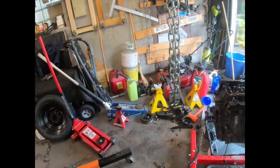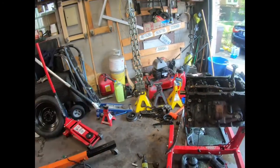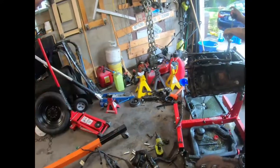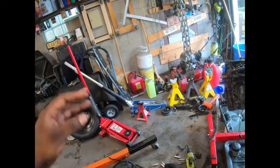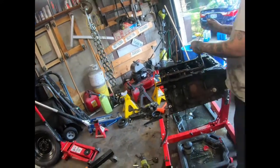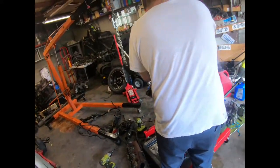We're changing the timing chain on it, and changing the timing guides and that cover. And I'm like, yo son, I do not know how to do timing. I never did timing before. You sure you want to put this back together? He's like, yeah, throw it together. Threw it back together, boom! There goes the motor. It was out of timing and blew the motor. So now we had to get another motor.